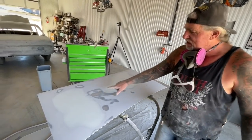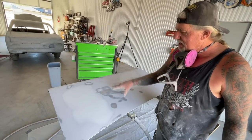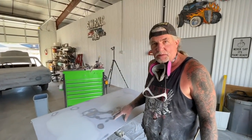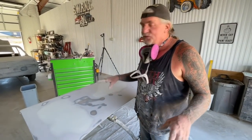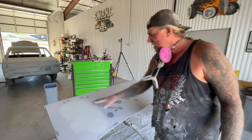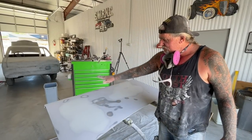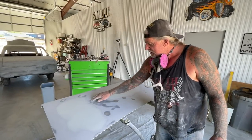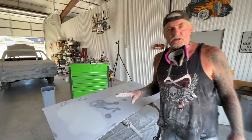I've already done the body work underneath — you can see it right here. It was stripped to bare metal. I went in and did the body work, epoxy primed over that, put three coats of polyester primer — not spray-on Bondo, polyester primer. Then I blocked it out to find my low spots, and we found a deep low spot pocket here, and two right here. You can see where I was blocking it out using my speed file, and we got a low spot right here, and it's a little low over here because we're hitting metal. So I'm going to show you how to float this out — real quick and easy.